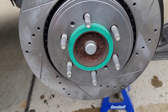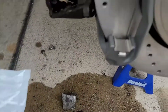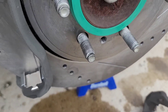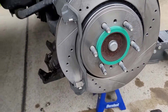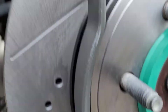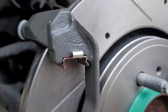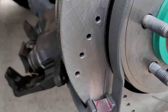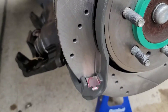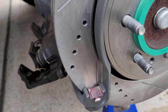The kit came with new clip-on slides for the brake pads, which I've installed. I also wiped off the rotor because there's an oily film on it from shipping to prevent rust between manufacturing and purchase. I put a small amount of brake lube grease on the slides to keep the brakes quiet and sliding easily, but only a very thin layer. The brake area gets hot and grease will liquefy, so you don't want liquid grease getting on your rotor and causing braking issues — use it very sparingly.